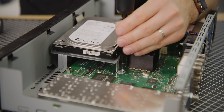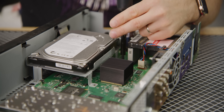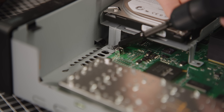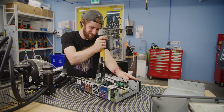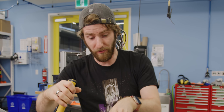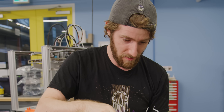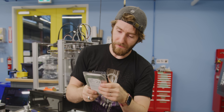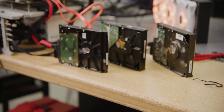Still, this is at least worth extracting. We take out two standard Phillips head screws right here and here, then do a little bit of negotiating because the other side is held down by these little bent metal tabs. A few more screws to remove the hard drive from its sled, then we pop this guy off — et voilà, completely standard 500 gig drive.